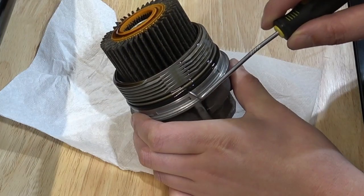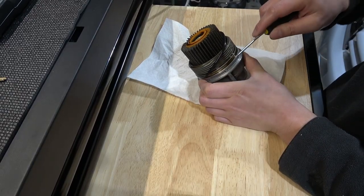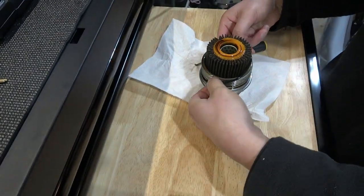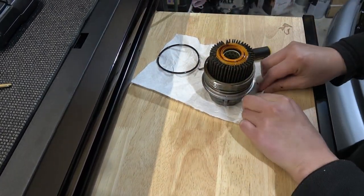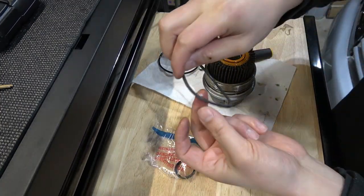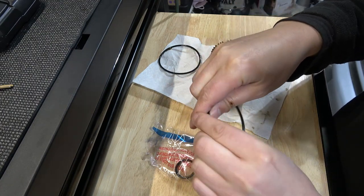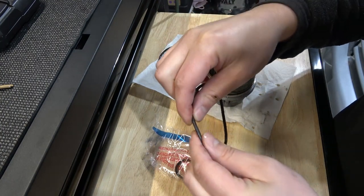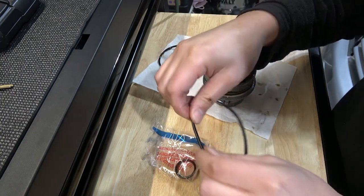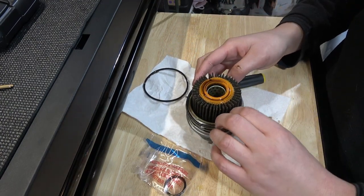Taking a look at this filter housing, you can see these bottom two wider gaps — there are little ridges. You're going to need to remove this O-ring and make sure you put the O-ring back in the exact same spot, right here, so you get a good seal. I've got a little dab of fresh oil on my fingers and I'm going to rub it all the way around the O-ring, just to make sure it has some lubrication to help it slide into position so you don't tear that seal. Then we'll put this right back down onto the filter housing.